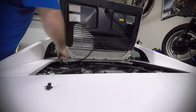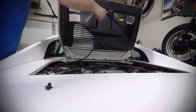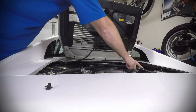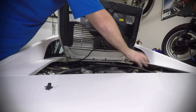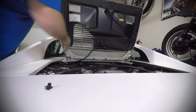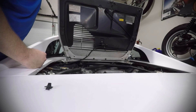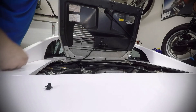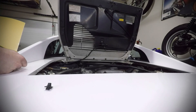I've got another one on the front hood prop rod, but I'm going to replace that one with a little gas-charged strut. I hate hood prop rods — it goes right over where your oil filter is, and there's a lot of maintenance items on that side of the car, so it makes sense to put a strut over there. It cleans up the engine bay a lot. So this little clip was just something I printed for fun. Anyway, thanks for watching — catch you next time.